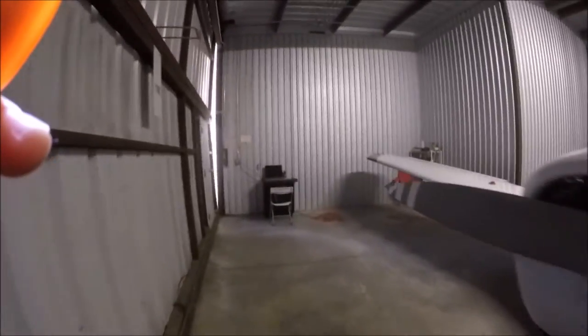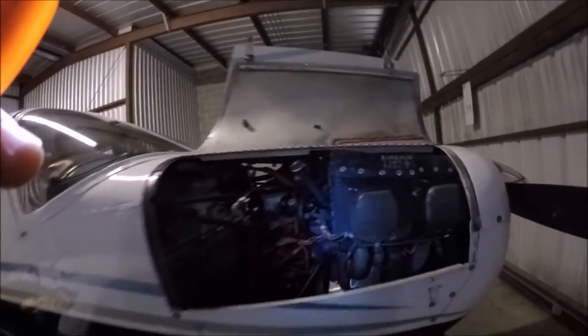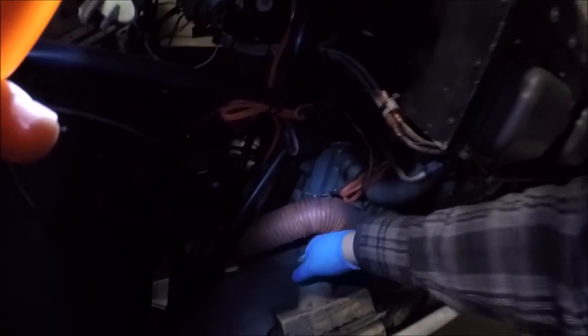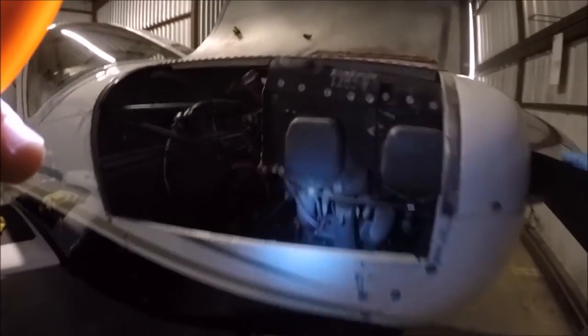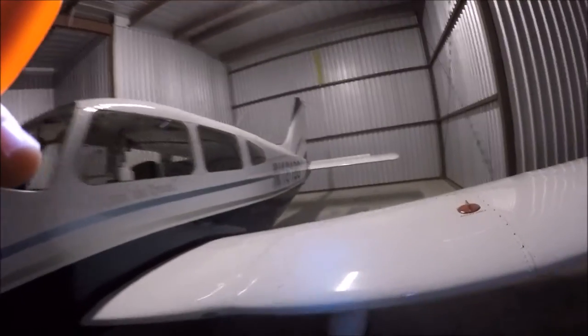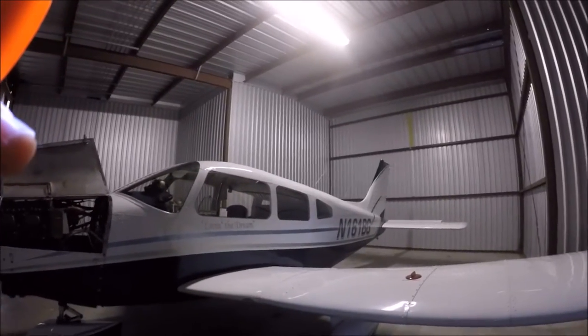On the ground, these look fine and they're easy to overlook. However, in the air, having an engine cowl flap flapping up could cause an emergency very quickly. Additionally, I've had it where one of these inlet pipes was actually disconnected after an annual — there were two disconnected, which would have done great harm to my engine had I not done a very thorough engine check. Just simple stuff: keeping your plane clean and making sure you run your hand along the entire body of the aircraft makes the aircraft happy and makes you happy, because you will experience fewer issues by doing a thorough check.